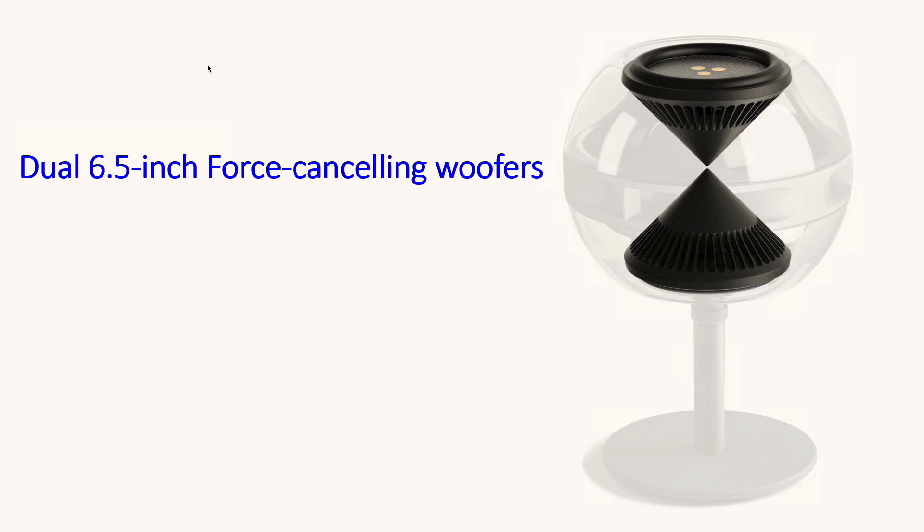In my demos I used the fully stacked version to get the speakers up to about ear level without having to set them on a table or stand. Let's talk about the woofers — they're mounted in a fully sealed enclosure and are opposite firing, which means they provide some force cancellation. Essentially that means the speakers are in phase acoustically in the room but mechanically out of phase when attached to the Sing itself, which limits transmission of vibration. In fact, you can stand one of these on a table with a glass next to it and in my experience the glass wasn't really moving — it's really something to behold how well the vibration is cut with force cancelling woofers.